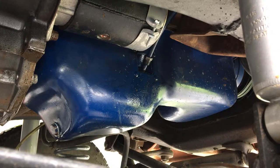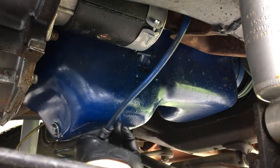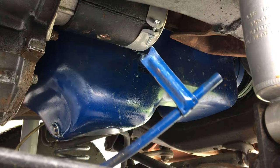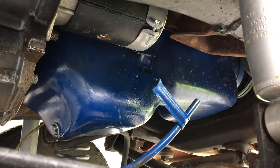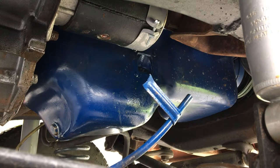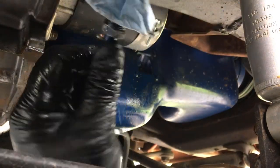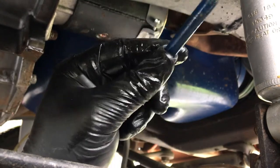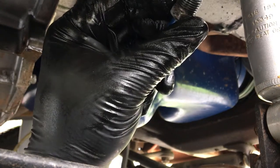Going to the top side now. I did not pull out the dipstick itself - just pull it out and get it out of the way. On these they have a tab that goes to your exhaust manifold. This being the original dipstick, that broke off when I had to replace the exhaust manifold on this side - for some reason it cracked right in half between the first two and last two exhaust ports. What I'm thinking is I'll clean this up with a wire brush, put some RTV black on there, tighten it back down, and maybe some pipe thread tape.